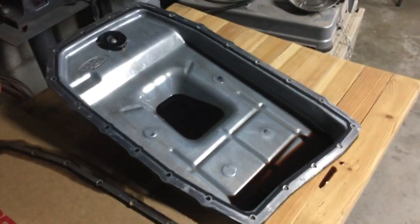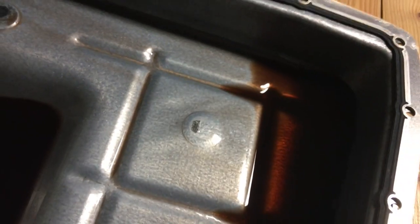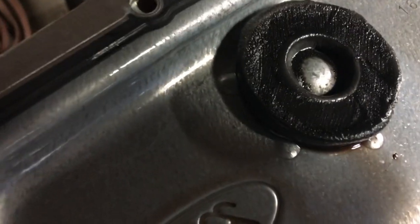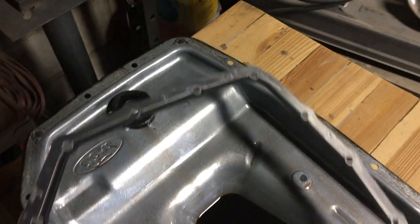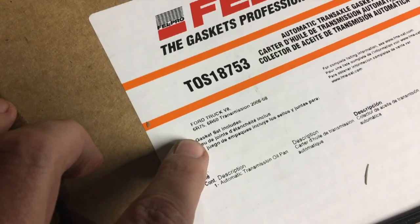Okay, so I've got the pan off and there's still a little fluid in there to dump out. Taking a look at the fluid, the color is decent — not too bad at about 75,000 miles, nothing unexpected. There's a little bit of sludge and particles built up on the magnet to clean off before putting it back together. Most importantly, I test fit the gasket and it fits just fine — even though the box states it's the 6R75 or 6R60 gasket, this is the 6R80, so that's good news.